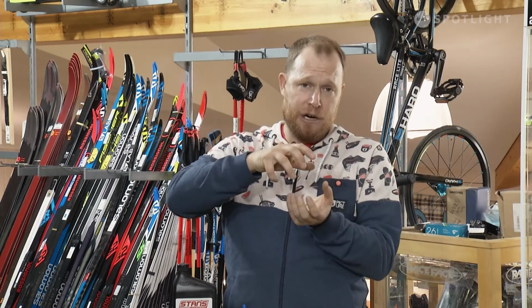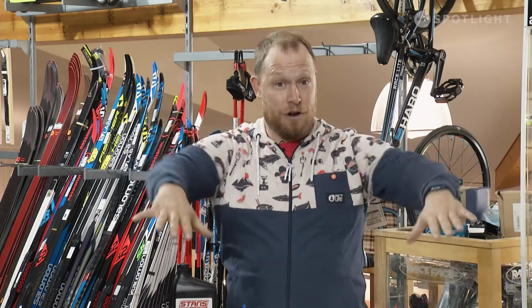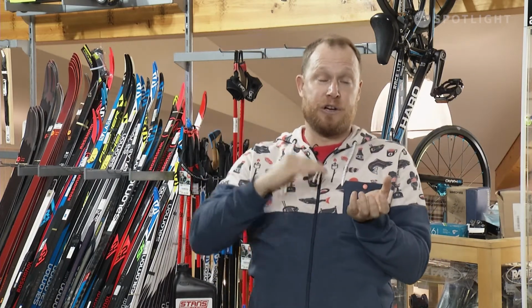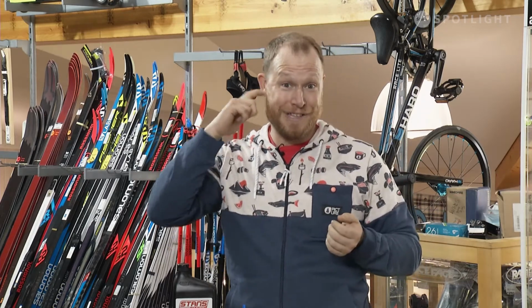The fact of the matter is that the tire pressure on a mountain bike is the first level of suspension. It's the suspension that's supposed to eat all the small little bumps that you can't see. Next, you've got your suspension on your bike that'll eat the medium-sized bumps. Then you've got your arms and legs to move to absorb the big bumps. But if you consistently have that tire pressure at a consistent PSI, you will find that you'll move through the trails either more confidently or quicker, depending on how you choose to use that.